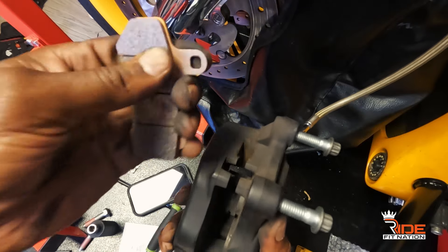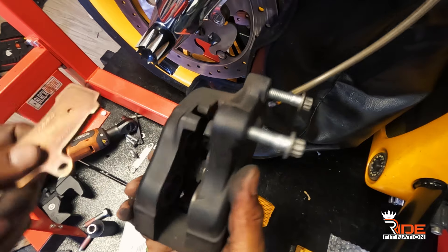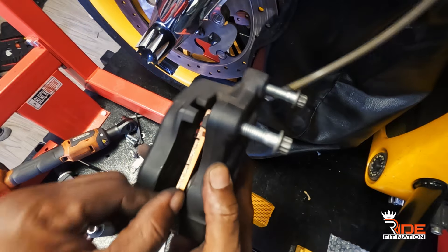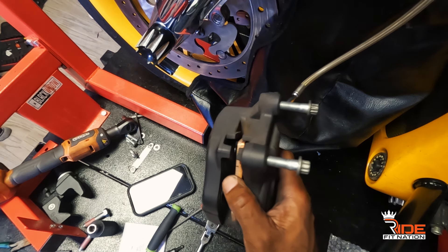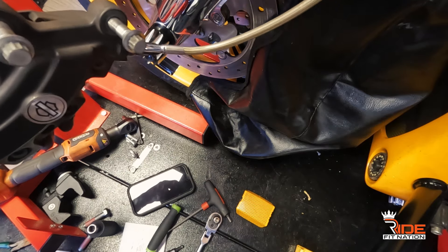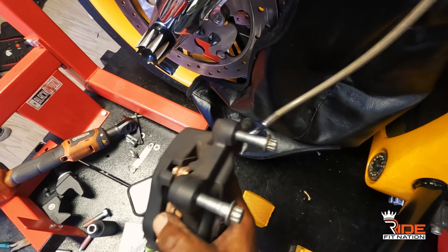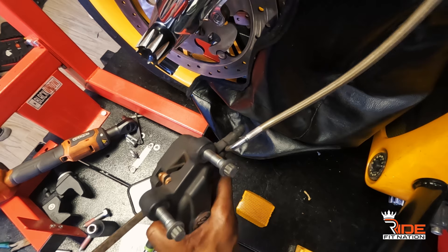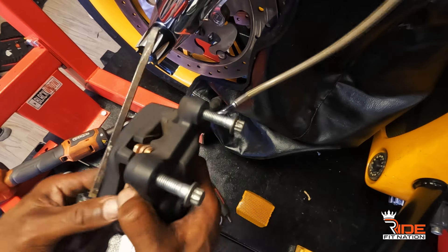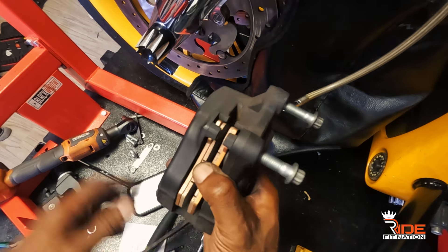You can't get this wrong. The bolt goes right inside these little holes to keep it in a spot. You're gonna look at the shape of the calipers and slide the pad in — it's gonna lock and drop into place. Take your time, it's gonna drop in. Do the same thing for the second brake pad, push it in on this side. I'll gently use the screwdriver just to make sure it falls right where it needs to and I get a good opening for when I put it back on.